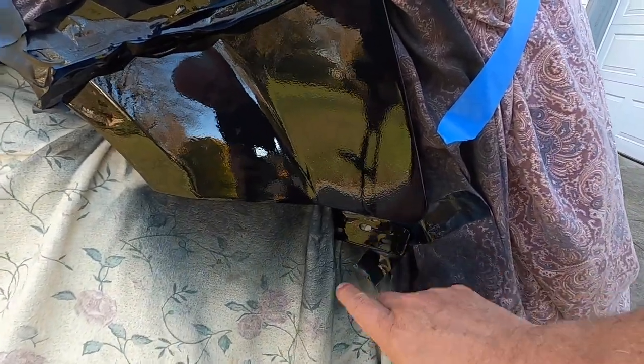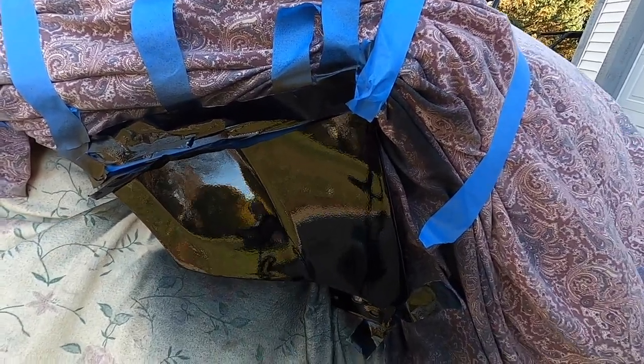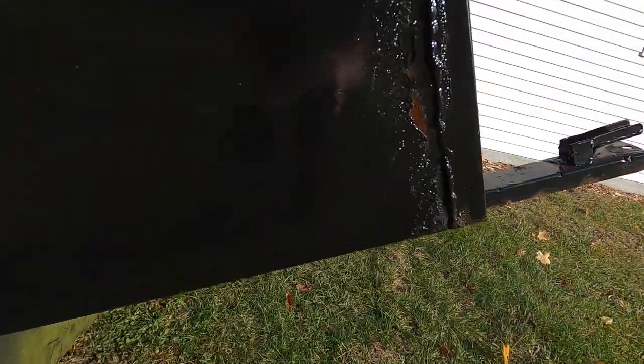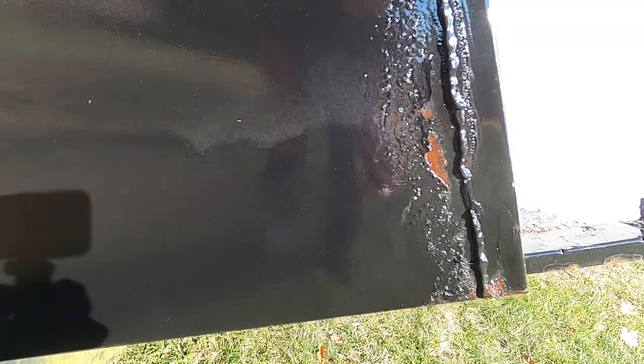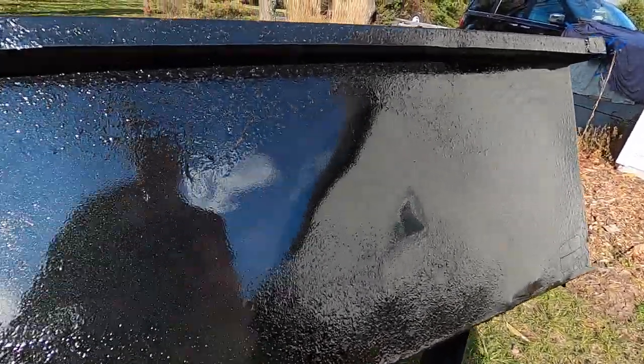It's still a little on the tacky side to shoot another coat, and I think the next coat could go on just slightly wetter. Yeah, that run stayed. I don't know if that shows up in the video, but it's kind of milky looking. That's why you don't want to get heavy runs like that. It's all the air bubbles in it. The front, the metallic, see, now that could be coated. It's almost too dry. It's not tacky at all, because it's here in the sun.